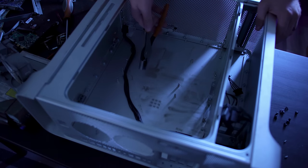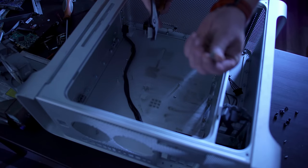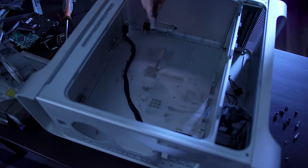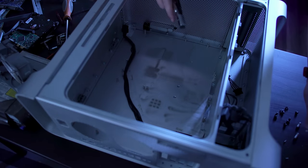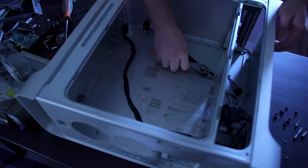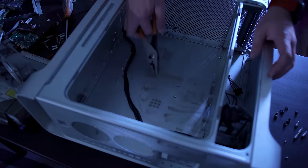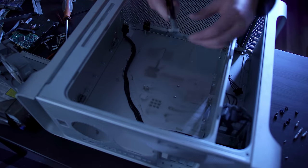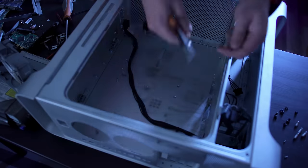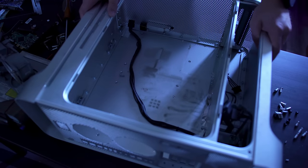The first thing you're going to want to do is take your pliers, go through and carefully grab your motherboard standoffs that are in there, and just pry them to the side - they pop right off. Put all of them to the side so you've got all of them when you go to reattach. They're super easy to pop off, so if you're pulling really hard you shouldn't need to. The only ones you can get rid of are the ones with a little nub on top - those are just to center the motherboard.